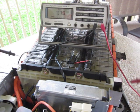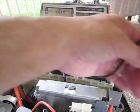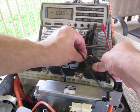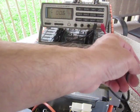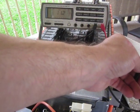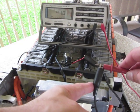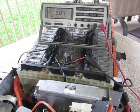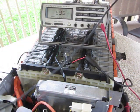What happens when I put a load on this cell? Let's check. We take an alligator clip wire and connect one leg of the light bulb to the power terminal — just clip it on there. Then take another one, this longer one, about two feet long, an alligator clip test lead wire.